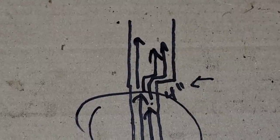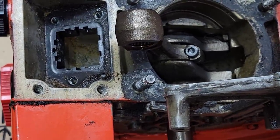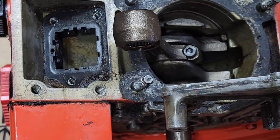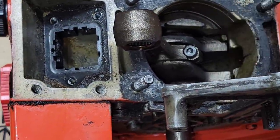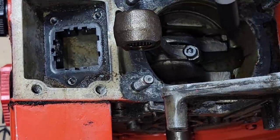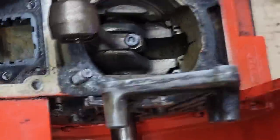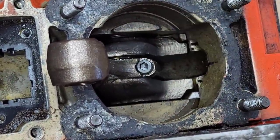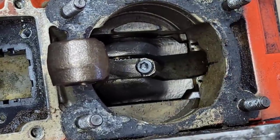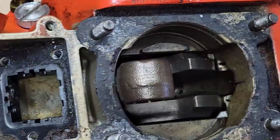So the question is: do we hog out these cases? We were talking about case trenching in an earlier video. Should I trench these cases? That would involve completely splitting this saw and matching the transfer here by grinding this out to the case. But there are two little nubs in the way right here, so I'm trying to decide what to do with those. I could probably smooth and alleviate some of that, then trench out in to here.